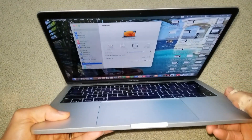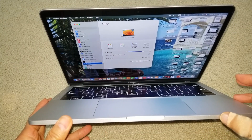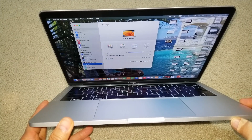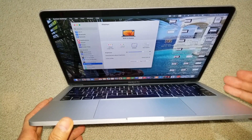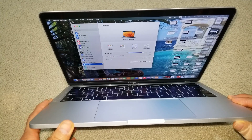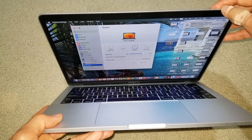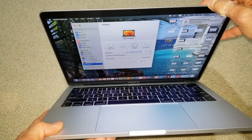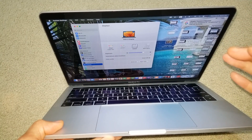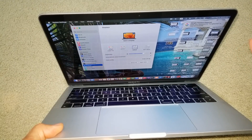As you can see, the display is on. Originally I thought that was a battery problem, but the battery also needs service. If you keep on plugging and unplugging more than a certain cycle, you need to get a battery service. So I'm going to open it more than 90 degrees and the display is going to disappear. When I open it, it got dimmer — the flex cable is being separated little by little and all of a sudden it's going to disappear.